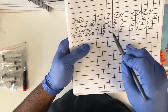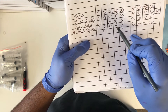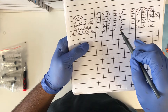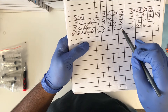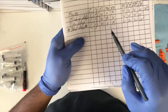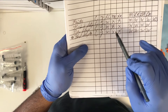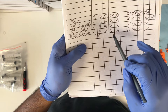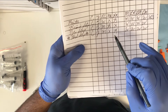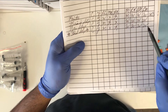The right side will replace magenta, light black, light light black, and light magenta. We'll have cyan, yellow, magenta, and matte black. Black won't be used so we'll keep the cleaning solution in that channel. For the photo black channel we're actually going to use the black DTF ink. I was told that matte black and photo black operate from the same ink line — they have two separate lines but swap through channels similar to the Epson 3880.